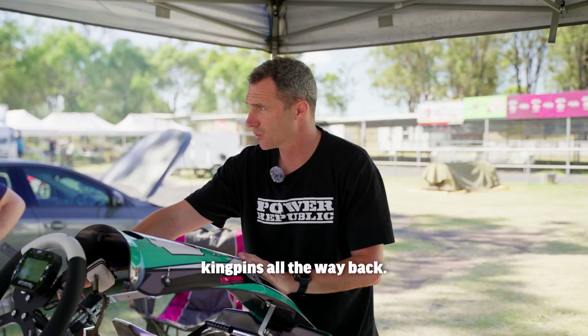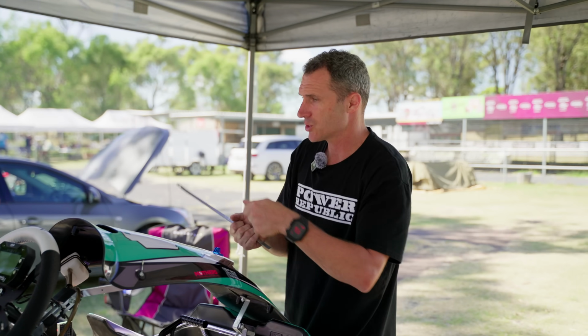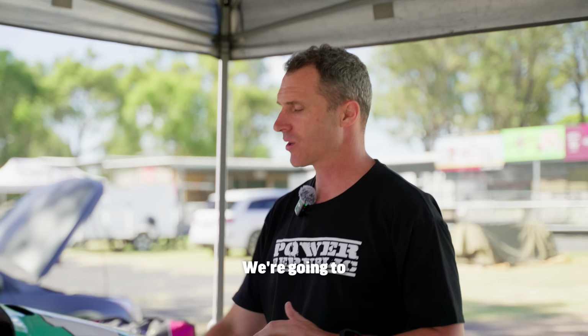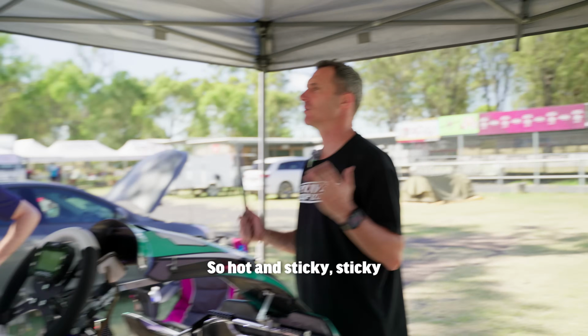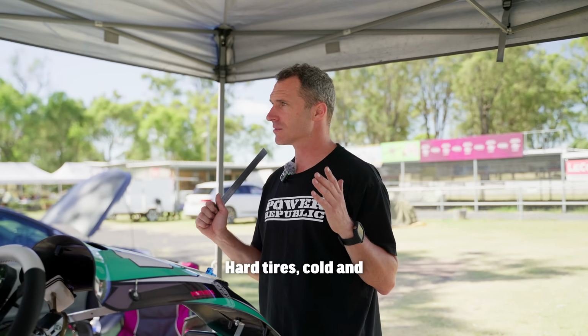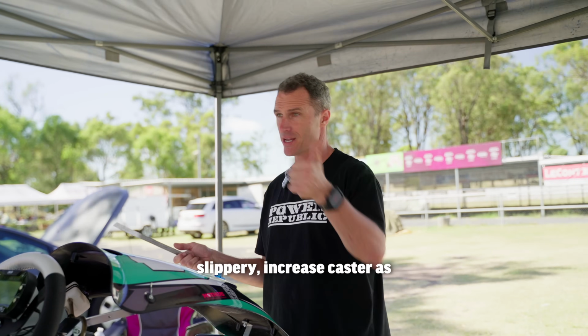We're going to put the kingpins all the way back, try to get some jack, twist, generate some heat. But up here we don't need heat. Heat's the enemy. It's the middle of summer, it's Warwick, it's hot, sticky, the track's in good condition. We're going to reduce our caster. So hot and sticky tyres, reduce caster. Hard tyres, cold and slippery, increase caster as a rule of thumb.